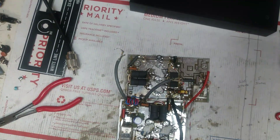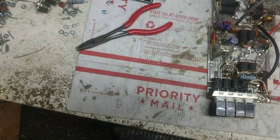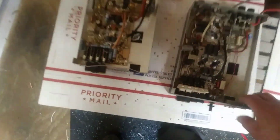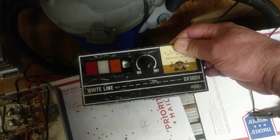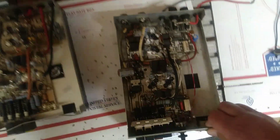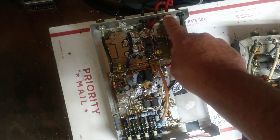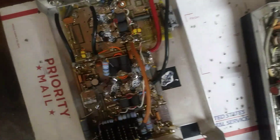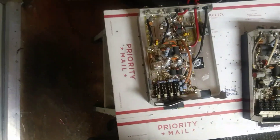That's where we're at. There's your sink, and there's the other part of it. Top covers here. That's a white line DX400 — same thing. And this is a white line 500, but the face isn't as nice a shape. You'll notice on the 667 they don't have the fuse holders, unless somebody's already done a power wire upgrade, which I believe they have. So that's what's going to happen here also — going to eliminate the fuses.